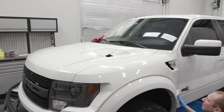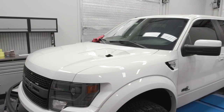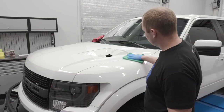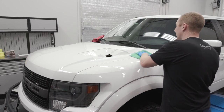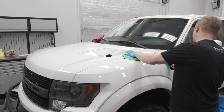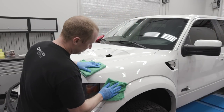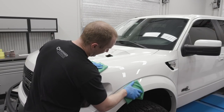It's really odd — the whole thing. I feel like I'm living in some bizarro world. Okay — wipe the fender. Remember, we need to chase adjacent panels, make sure you're not pushing coating onto the next panel and forgetting about it, ending up with a high spot and negating all the work we just did. Man, this truck came out so good — so much better than I thought it would.